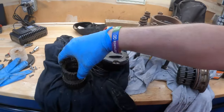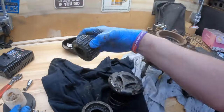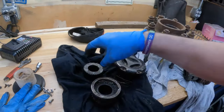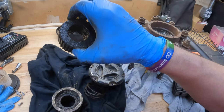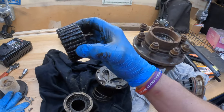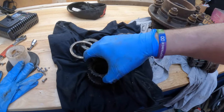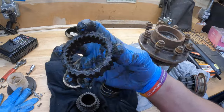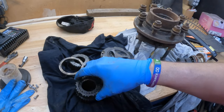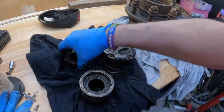four liter power. But as you get into the heavier power, bigger tires and things like that, that's when something like this becomes way more ideal, because this, like I said, is solid hardened steel that's got to be at least, I don't know, shoot, probably at least half inch thick. That's about an inch and a half wide, versus this gear set here, which is maybe quarter inch, maybe, and all these teeth. Like, this can break, this can shatter. So that's why I'm really leaning toward the drive slugs or the drive flange being the better alternative here.